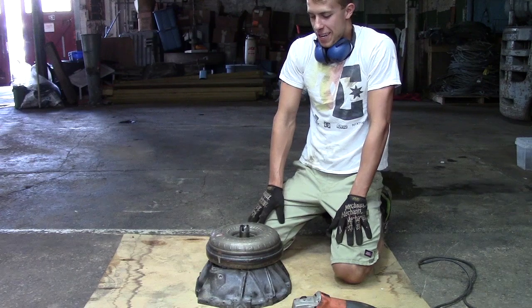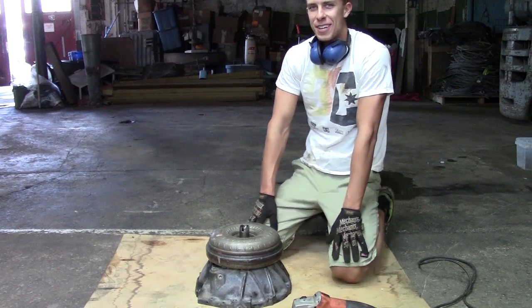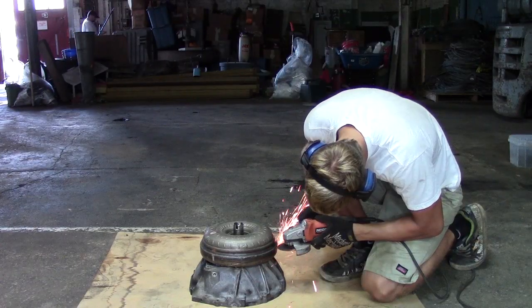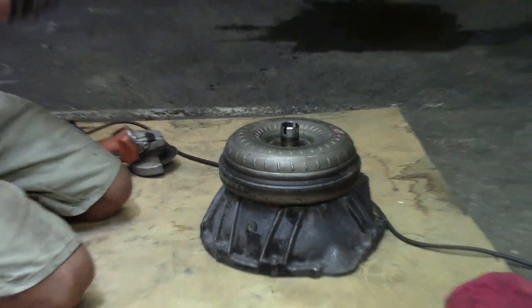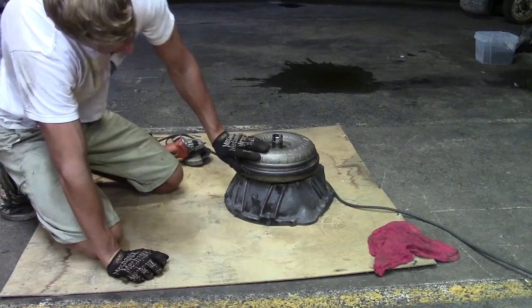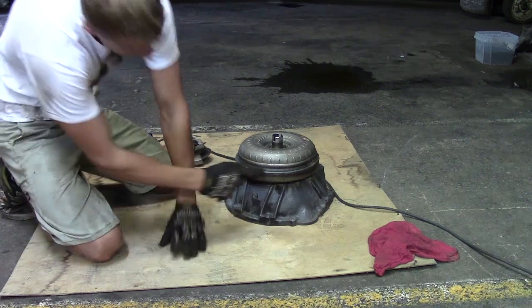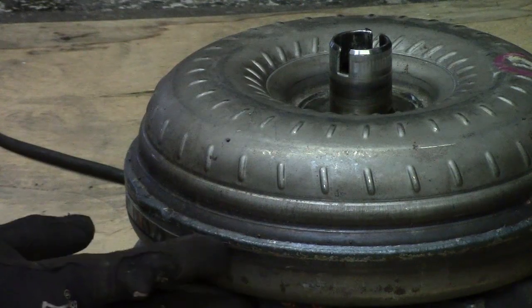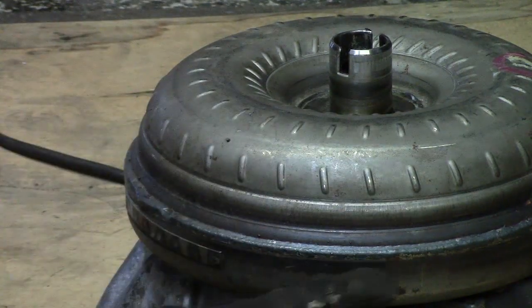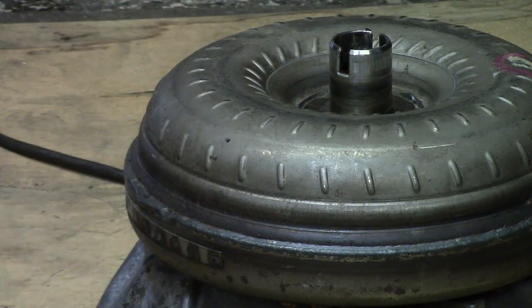Welcome to Core Man Mods. Today we're going to cut apart this torque converter so we can tell you guys how one works. When I'm doing these cuts I'm placing them strategically, because a torque converter is made out of two stampings sandwiched together. Right here's a weld — you can see this is one part and this is the other part. Here's the seam weld. I'm cutting underneath that weld because that's where it'll free up everything so I can split it in half.